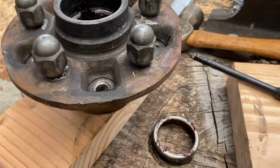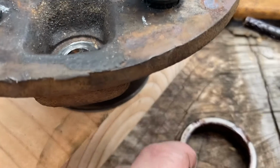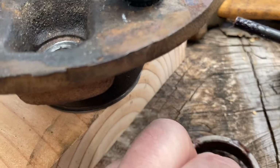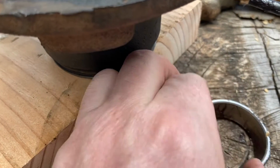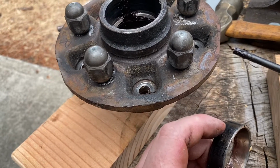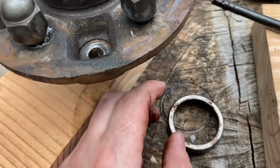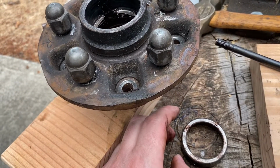All right, guys, so we have successfully removed the outer bearing. As you can see, this outer bearing has Japan on the side of it, and it's an NSK bearing. But what you can see inside this race, it's got some wear inside here, okay? It's discolored. When I removed this bearing, it had a Timken bearing installed into it. At some point, somebody removed the NSK Japanese bearing and installed a Timken bearing, exactly what you're not supposed to do, but obviously somebody did what they had to do to get it on